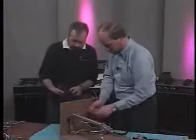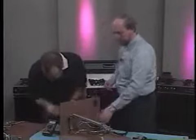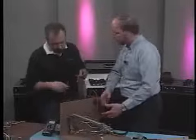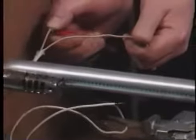You know I don't like this meter, but we're going to do it anyway. The first reading I would take would be the resistance of the igniter itself. Okay, here, you go ahead. I'll look at the meter. Okay. 54, 55 ohms. Now that's going to vary. It may be 50, maybe 150, but what we're looking for is a short or an open.